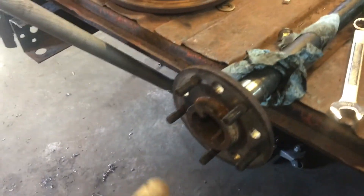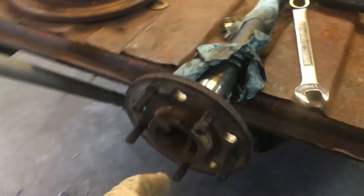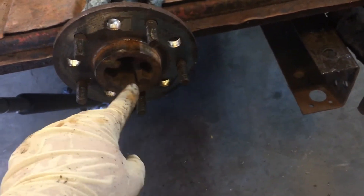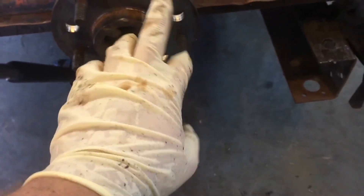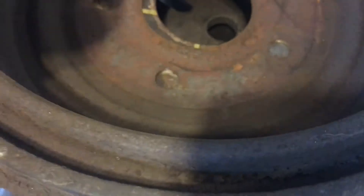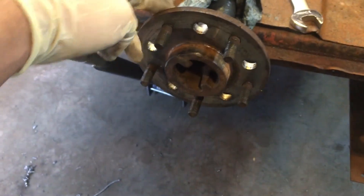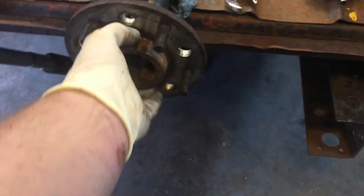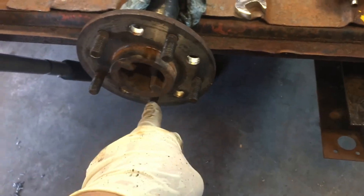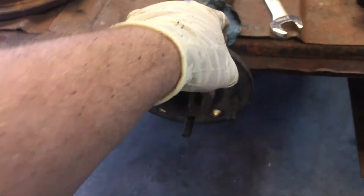Okay, I started watching my video and there were two parts I thought weren't clear enough. When you pull these axle shafts out, you want to pound out the old studs. Then I set the drum on there and just eyeball-marked with a yellow marker — here, here, here — and then you line the holes in the drum up to somewhere there. You put a yellow marker there, these holes weren't there clearly, then you line it up to the yellow mark. After I drilled the first hole, I put a stud in there just so I knew the whole thing wouldn't move, even though it's hub-centric. If you really wanted to be sure, put one here, do the second one diagonal, put a stud there, and then the whole thing won't move. Then do the other three and you'll know for sure they'll end up right.